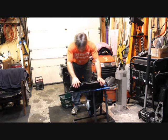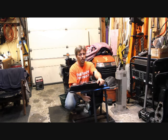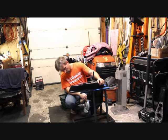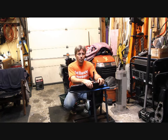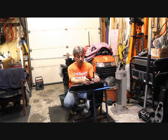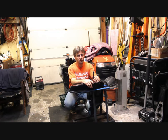Okay, we got it done — we got our bearing case assembled finally and we put it inside the lower case here. We torqued it down to 30 pounds according to the Volvo manual and we did our measurements with our dial indicator, another one of our top shelf fancy tools we seldomly use, but in this case it was the perfect thing to use according to the manual. We figured out how much gear lash we have — we are supposed to have between two-thousandths and four-thousandths, which is in inches, strangely enough, being that other things are in millimeters in the manual. So be careful of that.